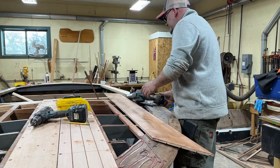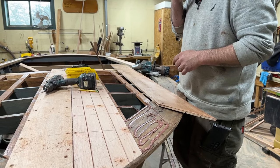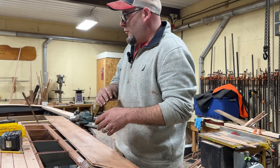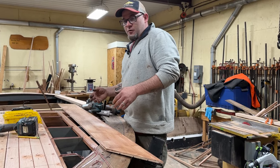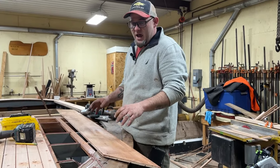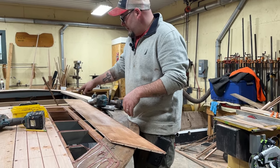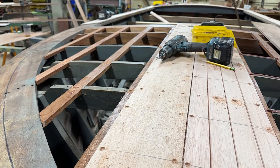So I realized yesterday, after I got the whole deck mocked up, I was pushing down and I completely forgot this was originally a plywood deck. There were no battens in here because there were virtually no seams. So I had to take it all off — I had to put CPES on the back sides of these — and I scored lines so anywhere there's a seam, I marked it out and put battens in there, so that way on every seam there is a nice joint.